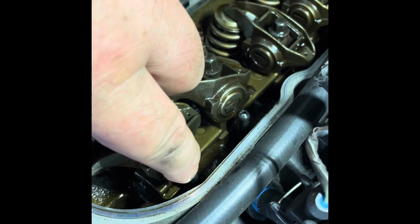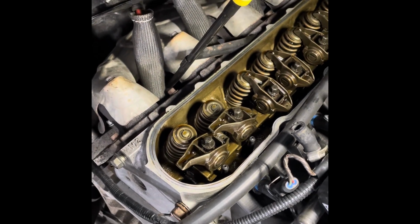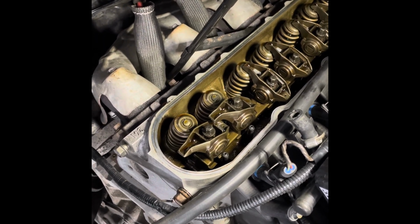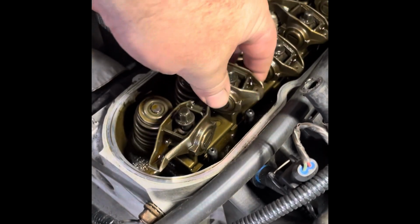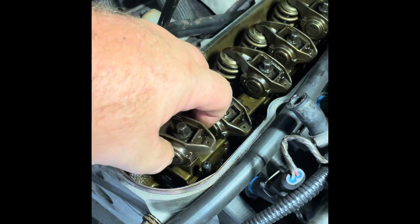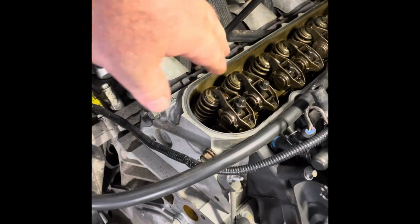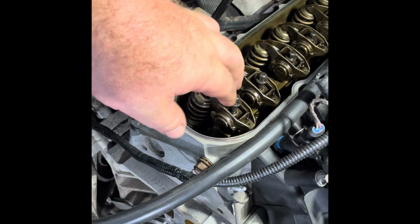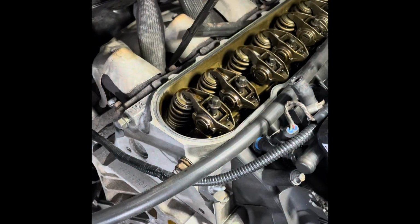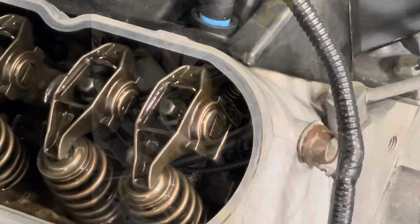So they're actually pretty firm, so I probably could have done that cam change without those bits of dowel, but yeah, just make sure you push on the push rods a little bit, push those lifters back down on the cam, obviously rotate the rockers back on, tighten it down. Now what I do is I roll the motor over until there's no preload on the rocker to torque them up. I'm going to do all of them except for this front one here, and this front one I'm actually going to test the preload, and I'll set up the tripod and we'll do that.